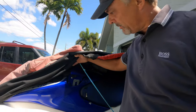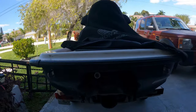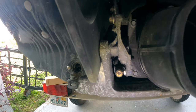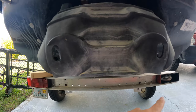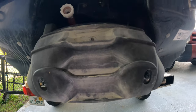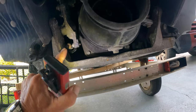Let's see what's actually wrong with this Honda jet ski. The reverse cable is the first issue — it does not come down as you can see, and it only moves up a little bit without full deflection on the rear. That means you'll never have full reverse or braking capability. The way it's designed is a bit of a weakness from the designers. In the back, this is basically the reverse that goes down and deflects the water flow about 30 degrees out to both sides — that's what creates the drag and reverse. The problem is on the left side where the reverse cable is attached.